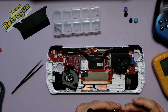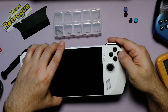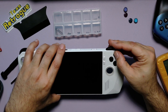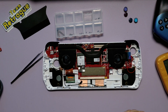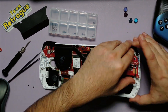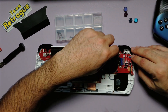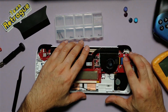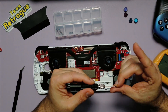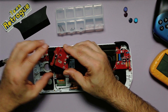Reconnect the ribbon cable on the bottom left, as well as the fans. Before going any further, let's just test these face buttons to make sure they work. We seem pretty good to go, so now we can start the reassembly. Let's start by replacing the two motherboard screws on the right, then we can connect the left joystick — reattach the ribbon cable and screw the joystick assembly back into place. Then work your way backwards, reattaching the motherboard screws you removed earlier. Once those are back in place, reattach the right joystick.